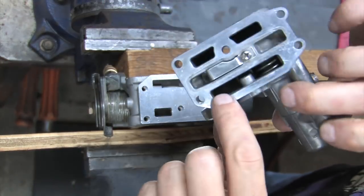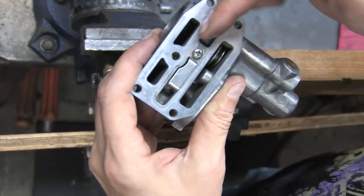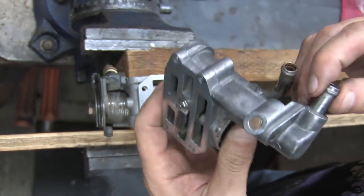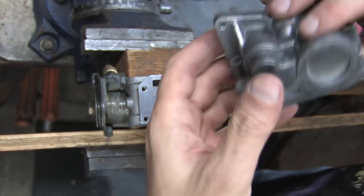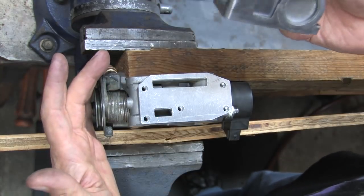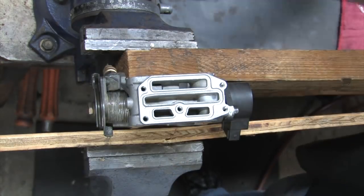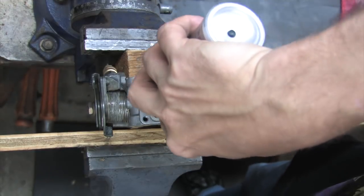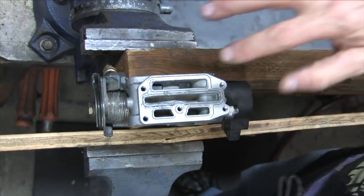This is the one that doesn't. This block-off plate gets sandwiched between the throttle body and the idle air assembly. There's also a free way to do this that I'm not covering in this video. That information is everywhere already, but if your fast idle air valve works and is not leaking on your street-driven car, why would you want to? The free mod is difficult to undo, but you can always just remove the block-off plate.